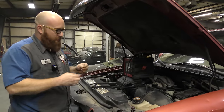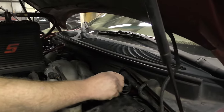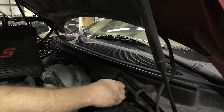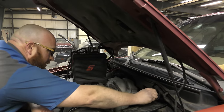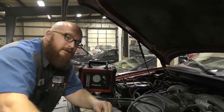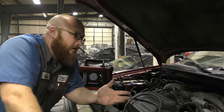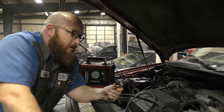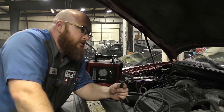But before we do that, we're going to put our Schrader valve back in the EVAP service port. Remember what I said about the threads being backwards — we're going to tighten it by going the loosey direction. Lefty loosey is actually tightening on this one. If you have a suspected intake gasket leak and you're concerned, wondering how do I even find out if it's leaking, I can't just look at it and see — this is where this tool makes it black and white. It totally gives the answer.